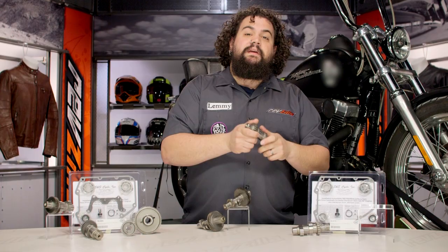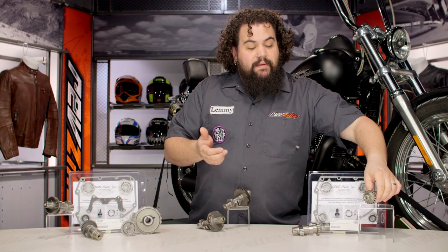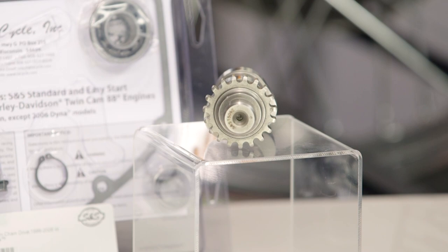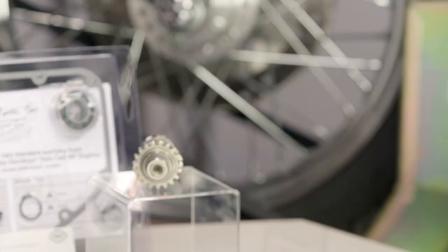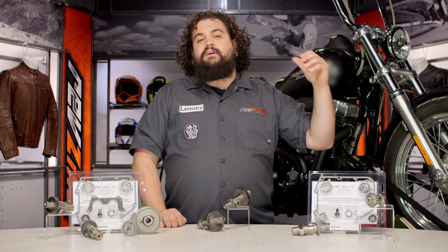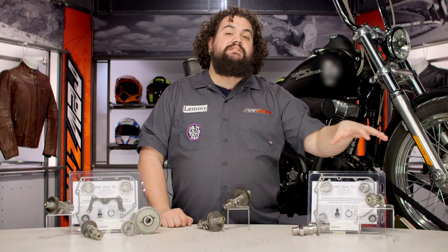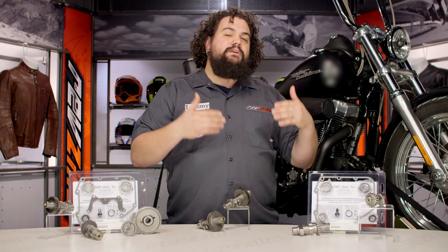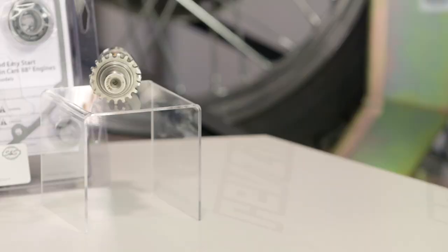The 509 is a very interesting cam — it's really designed to be bolted in. It's for those of you who have a reasonably stock motor and want just a little bit more pep and to move the power around a little bit. This is not a camshaft that makes the biggest horsepower numbers on paper, but that's okay. Horsepower on paper is not necessarily the ride you're going to be taking. When you use a 509 cam with its conservative lift and duration numbers, it makes your bike really fun to ride in the street — you can tap into that power low in the rev range. You're not going to have to change to high lift springs; this can be done in a weekend.